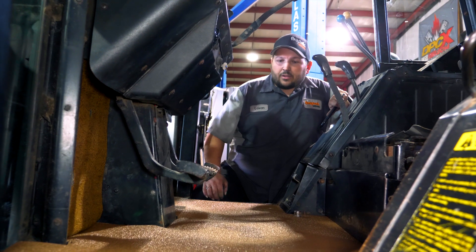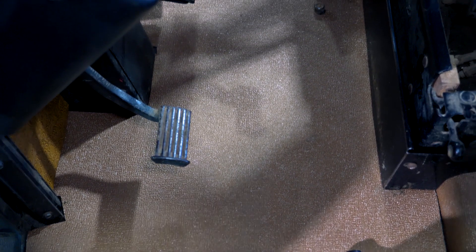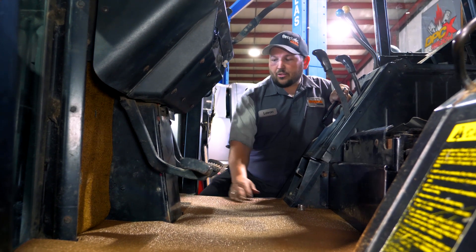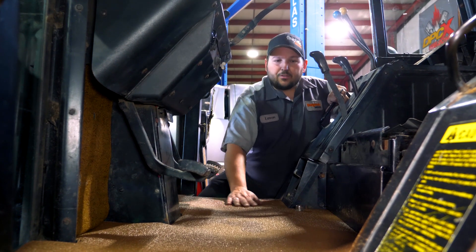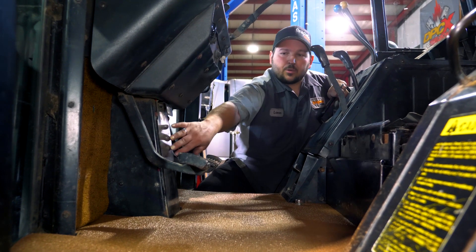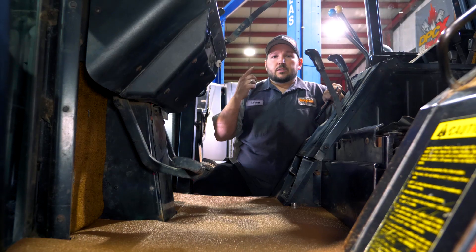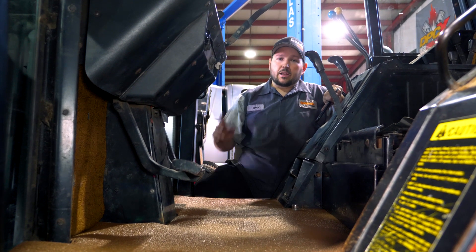I got the floor in — this is a pre-cut kit from Fehr. It's a little tricky because it goes around the cab mounts that stick up, so there's some padding underneath to try to get it as flat as possible. There's a slight wave in it but it'll mat down once we get some heat in it. I had to take the panel off to fit it under the seat, but the interior is pretty much ready to put the seat back in. I've got the rear window seal in and the radio going, so I just need to clean it back up and get the blower motor working.